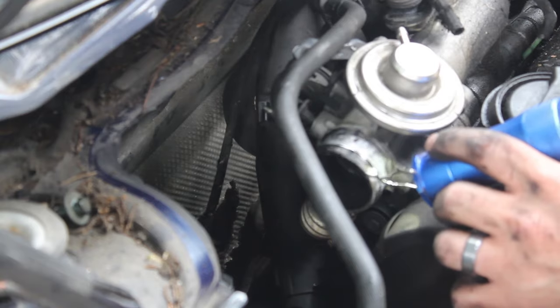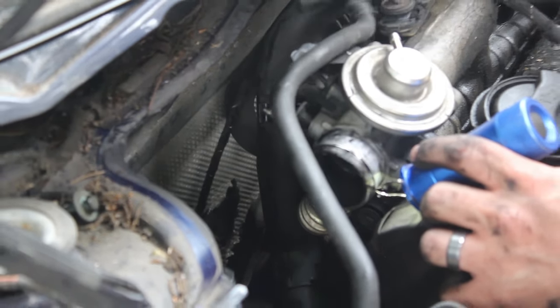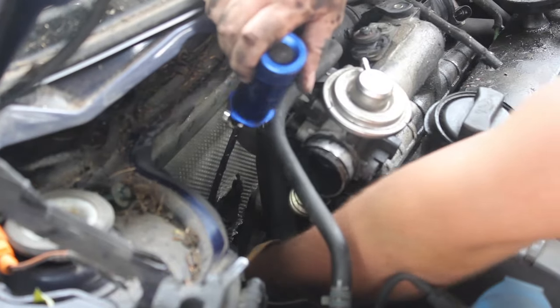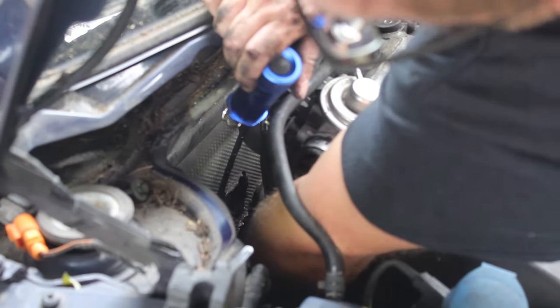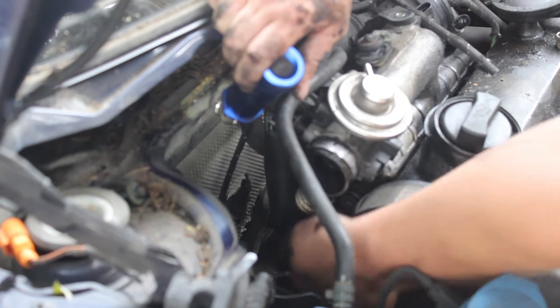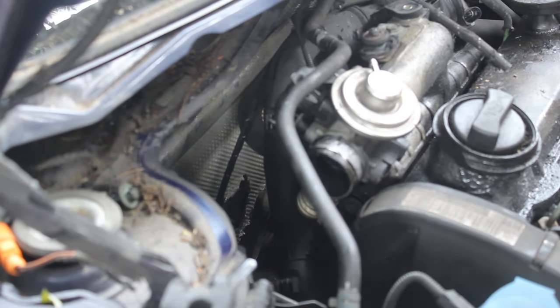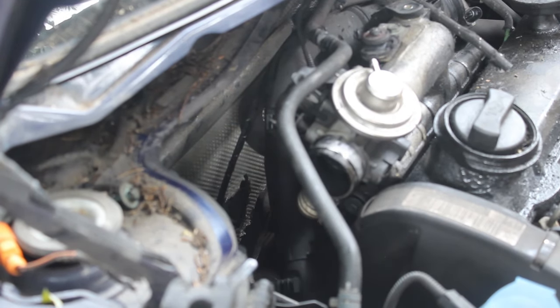With the whole intake tube loose and free of connectors, we are going to snake our hose clamp tool down to the other end of this line and remove the intake tube. Kind of a hard process to show you, so you'll just have to use your fingers on it and see the clamp down there.